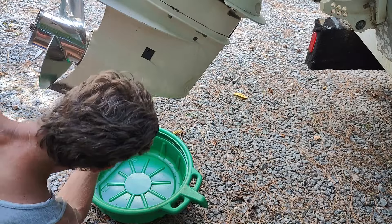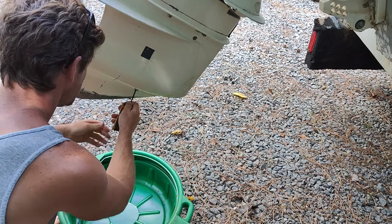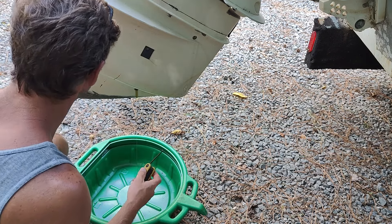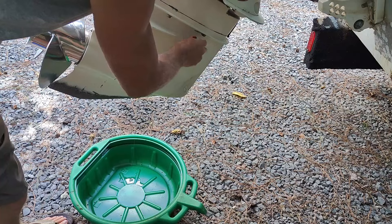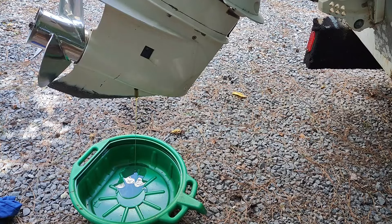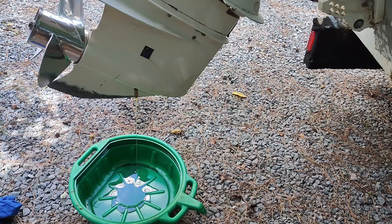Alright, we'll break these loose. Put this up here so I don't lose it. That well is looking good. We'll see if there's any water in it — the water will sit at the top, but it doesn't look milky or anything. Not like my Jumbo, where the seal went bad on me while I was running in and the lower unit basically blew up on it.